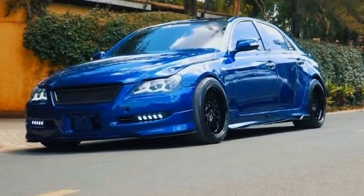Yeah, so Mark X and Crown usually have three different engine types. We have the 4GR-FSE, which comes with 2500cc. We have the 3GR-FSE, with 3000cc. And then we have the 2GR-FSE that comes with 3500. And we have the 2GR-FSC with a supercharger kit. Githinji, I know Githinji is vibrating wherever he is. So you need 3500cc supercharged. He's the one who opened the way for us to start doing this mod. He was brave enough to do it. So 3.5 for supercharged.